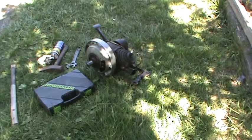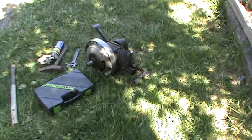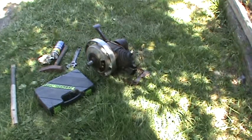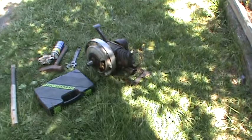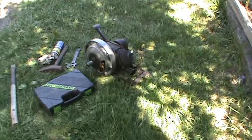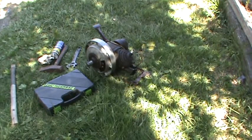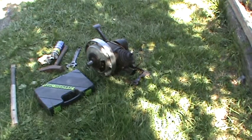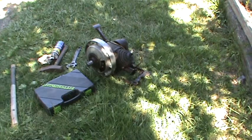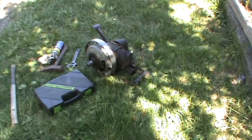I'd mentioned it before — you can lead a horse to water but you can't make them drink. Everybody's got their way of doing things. I always use the block of wood first. If that doesn't work, back that nut off until it's pretty much flush and maybe a little bit proud of that shaft. You want to protect the shaft — you can replace the nut easy enough, but the shaft is a different story. Then pick it up with your hand on one edge like I showed you and give it a firm smack. You don't got to beat it into the ground — it may take a couple of whacks.